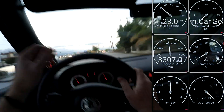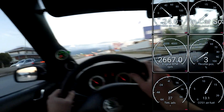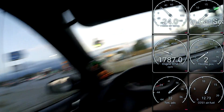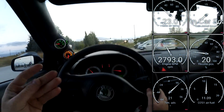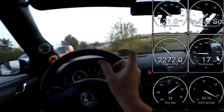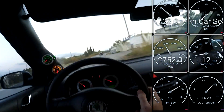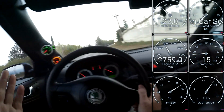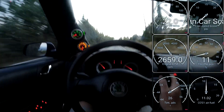I'm checking the gauges as well because the next thing on my hit list is to get the air fuel ratio sorted out, as it is a bit rough at idle. I've been saying that since the start of this project — the delay has been getting cable connectors for it. I'm going to put a splice harness in between the sensor and the loom, but those connectors are an absolute disaster to find. Hopefully in the next couple of weeks we'll have that ready and we can start fixing the air fuel ratios.